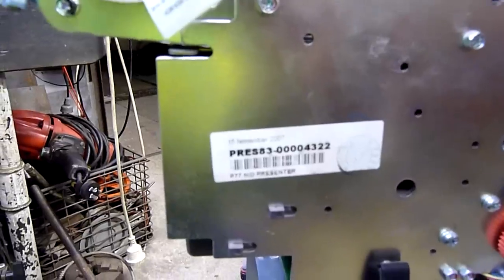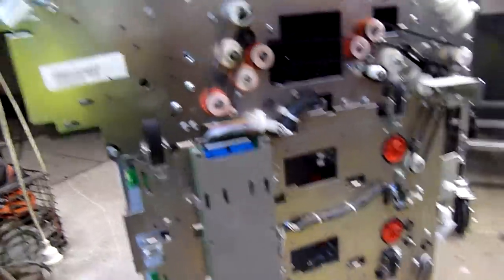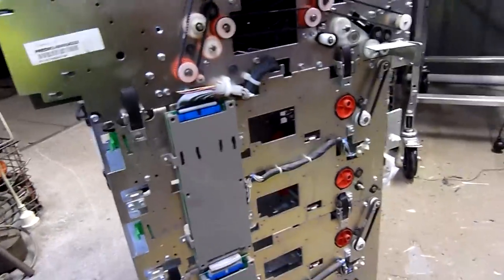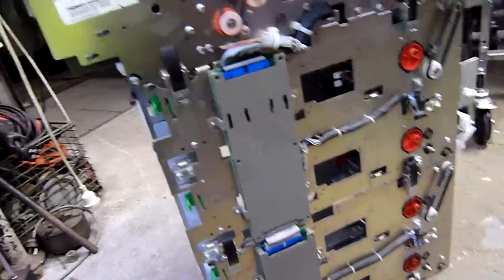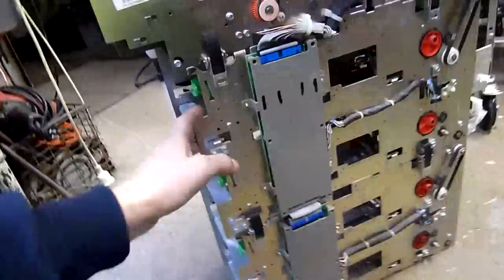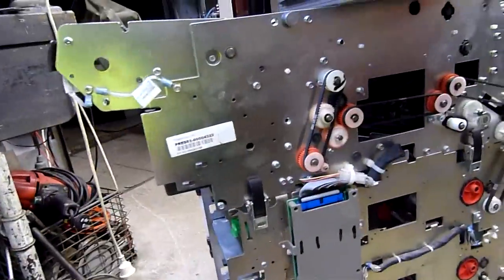There are plenty of online stores with e-manuals you can buy for around eight or nine bucks each that explain how ATMs work. The manufacture date is 2007 — it's not all that old, but it's an old design; it's definitely obsolete. They're running a lot of these out on GraysOnline and other auction sites. So let's get into it. These all come apart in separate sections — they're modular. You can replace this pair of cassette dispenser mechanisms, or this pair, or the top half.